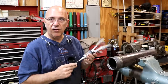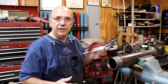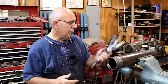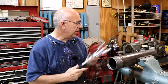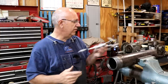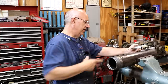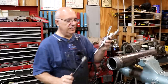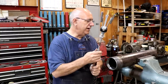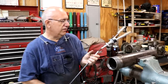What you're trying to do with this is put a crosshatch pattern in there at about 45 degrees, so you just kind of run it in and out fairly quickly. You don't want to sit in one spot too long. You want to use a little bit of lubricant in there as well. This hone is made for engines and usually the stroke on an engine isn't as deep, so I can't reach to the bottom without an extension. I've got a little drill chuck on a 3/8 inch rod that will allow me to go all the way up in there. Let me get that tightened up and get this on a drill and we're going to start honing the cylinder.